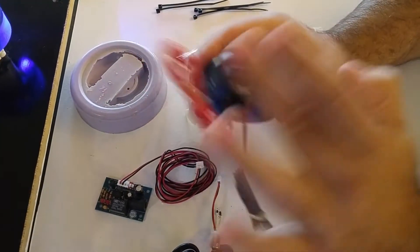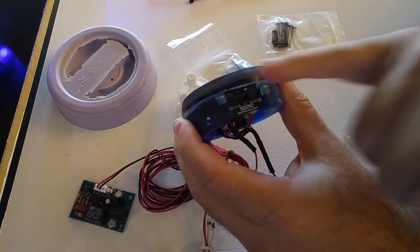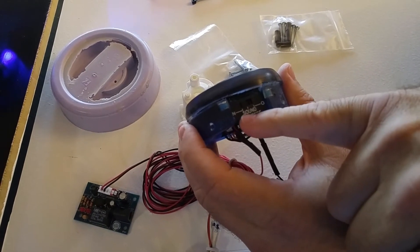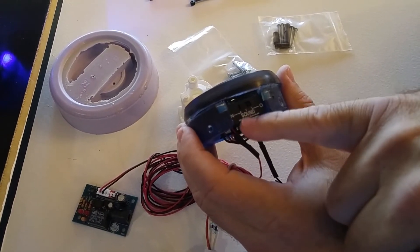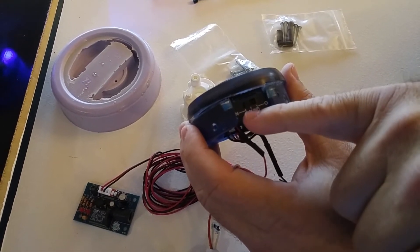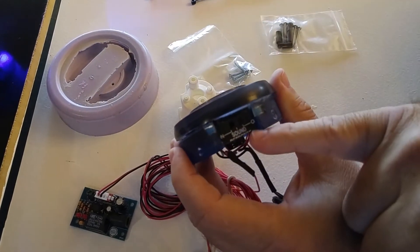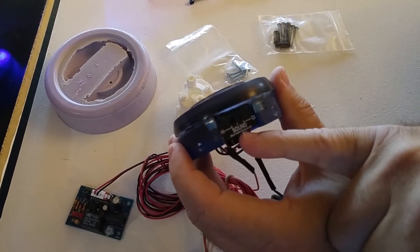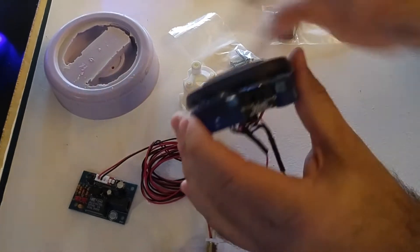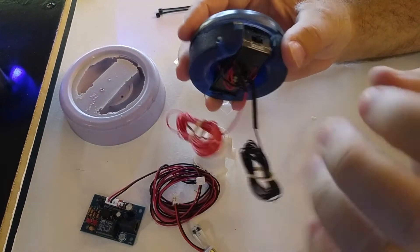On the back of the plasma is a control switch. You can have this on all the time — it's shipped in that position, and most of the time you'll leave it there. If you're working off your GI, you'll use that position. If you're going off the regular pop bumper circuitry, you'll use that position. In the center there's also a sound-activated mode. In that mode, when sounds are made in your game, your plasma will turn on and off. You would use your GI connection for that.